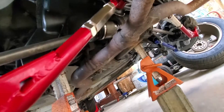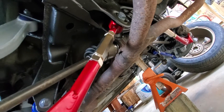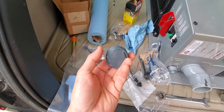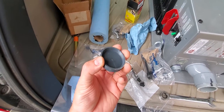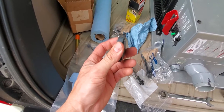I also had to replace the drive differential seal before putting the new axle in because it was torn. I 3D printed a little seal driver — it's a simple inch-and-a-half hex pattern on the outside, with a little printed part that fits on the end of a socket to drive the seal in. It worked pretty well, but I forgot to lube the seal before putting it in, so it tore off part of the rubber.